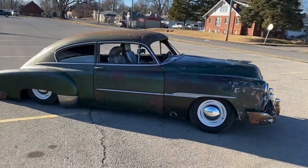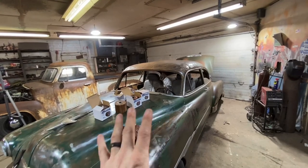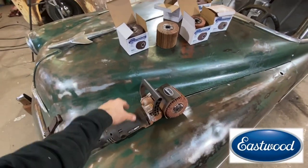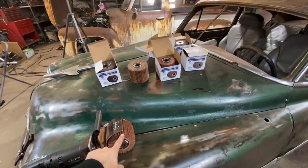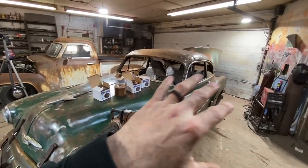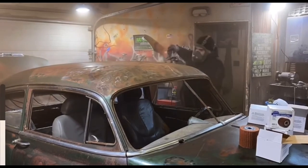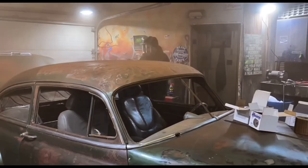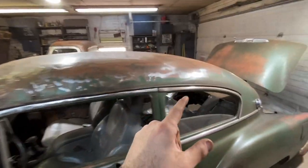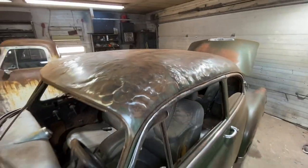It is time to start stripping this roof and get it ready for body work. It is in really really bad shape. I've got a lot of the dents out, I'm gonna beat around them a little bit more before I'm ready for bondo, but it's close. I got a new tool from Eastwood, it's called an SCT. This thing is a beast - it comes with a bunch of different drums, you throw a drum on it and it just rips through paint. Big fan of it. I had to put it in time-lapse because it was just throwing rust dust everywhere. Went down to bare metal in some spots I really didn't need to, but that's beside the point.